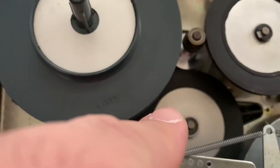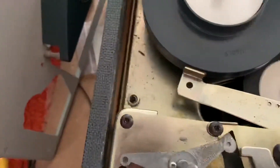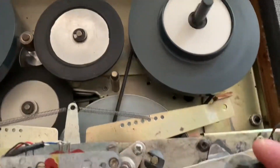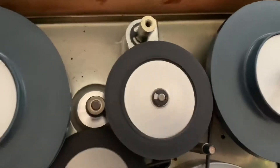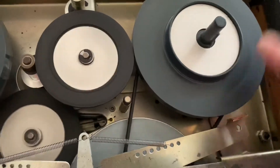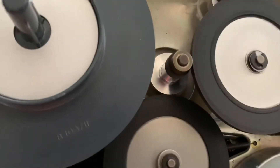You can see there's the motor, the three-step motor pulley, the other wheel which is driving the flywheel and driving the underside of the take-up reel. You can see the brake is engaged. When I put it in play, it releases both brakes and starts turning. If I put it in fast forward, this wheel swings over to the other wheel, which makes contact with the main pulley — that's a lot of torque. Here's rewind — when I put it in rewind, the supply reel mates with the main pulley directly.